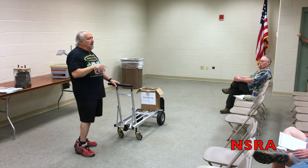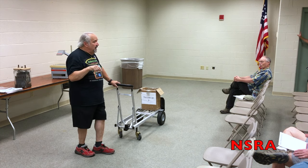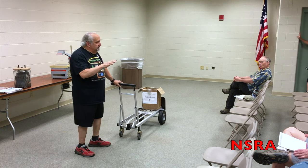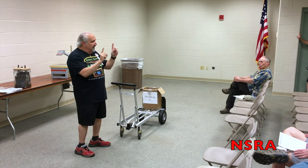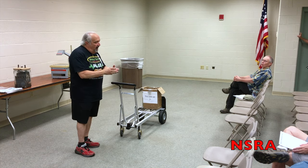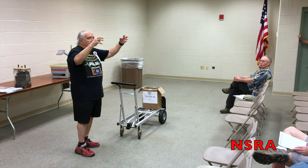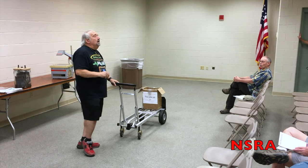If you ever wonder where the white stuff on the outside of your battery comes from, that's called hydrogen sulfate. It's the battery. All batteries gas. All batteries will vent. Even AGMs, even though you can turn them upside down, they have two little holes there. If they get too critical, they will gas instead of blow up. The problem with hydrogen sulfate is the hydrogen's coming out with the sulfur, and they get attracted to the post. They want to just go right there.